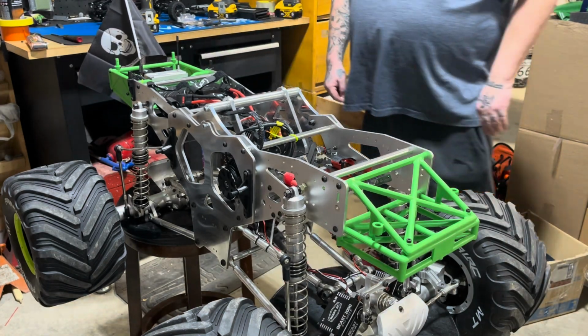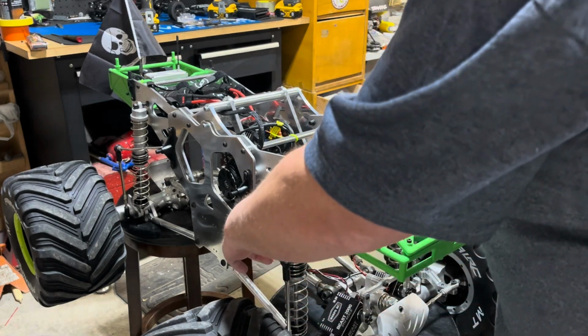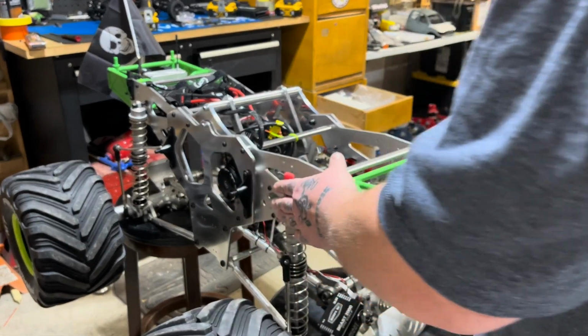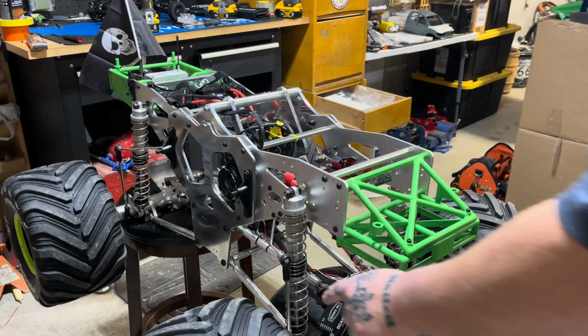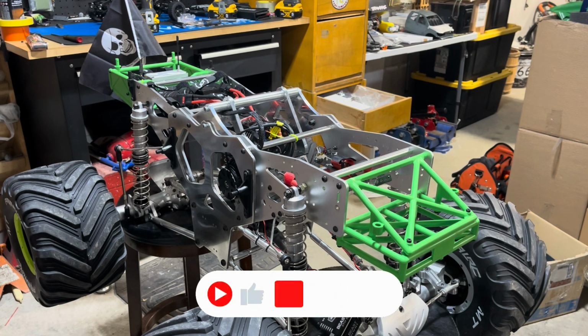And the only other thing I didn't do is there's different sway bars you can get that'll make it go around reservoirs, and there's a reservoir shock. And my shocks, I think the D2s or whatever they are, they have a bigger bore to them. I think that's what it is. You can check that out. And I put all new seals and everything in the shocks, new oil, and they still leaked a little bit. And I guess that's a common problem.